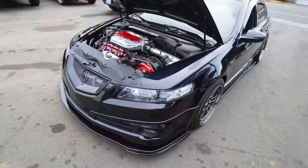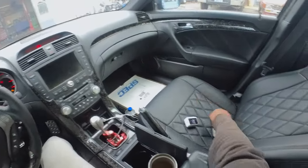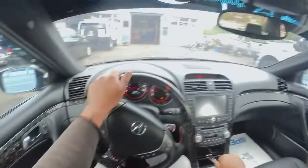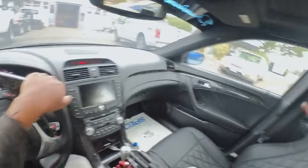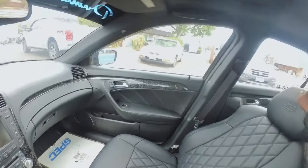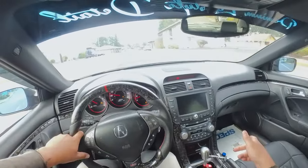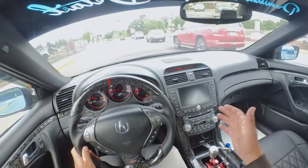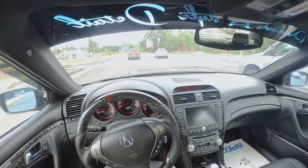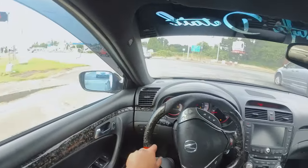The Allen just started to get a little loose. We just got back from another drive — no more leaks. It's 11. Talked to Taylor — he said it's gonna slip if you step on it, it takes some time to break this thing in. The mechanic didn't think that, but Taylor is very familiar with this stuff and I put a lot of trust in him. It's already feeling a little bit better though, starting to engage in the middle instead of the top. The friction plate we got was the wrong one — it's supposed to go with the Spec flywheel, and I have the Aceco flywheel on the car. That's why the bolts didn't line up. We're gonna order a new friction plate, the master slave, and the P2R braided clutch line. We'll be back next week to get that stuff in.